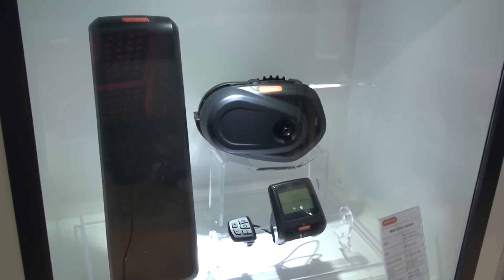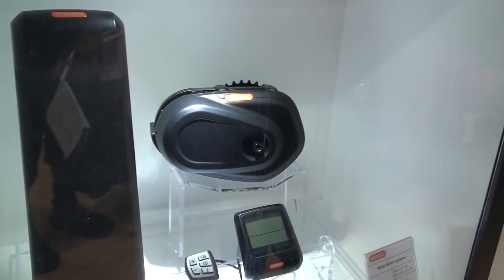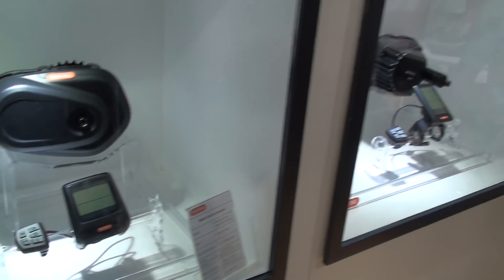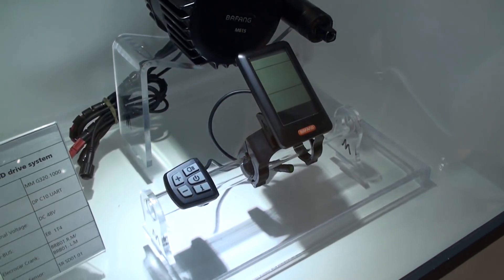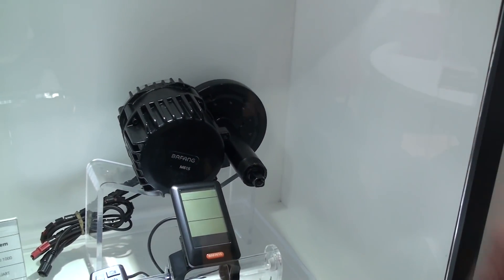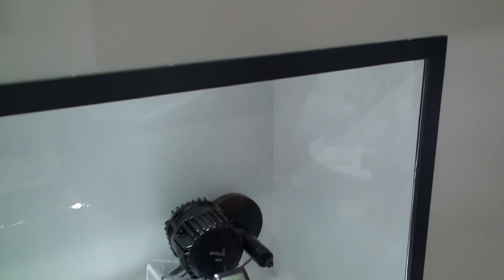This is our most popular mid motor — we call it the Max Drive. That was one of the first integrated mid motors from Bafang, very popular. We've sold roughly 100,000 pieces and you see it in a lot of European brands. This is still called the generation-one mid motor — you can retrofit it on standard bikes. This particular one, as you can see from the axle length of the bottom bracket, is for fat bikes. It's a 1000-watt motor, limited to speed sensor only, but it's very popular as a retrofittable kit in the US.